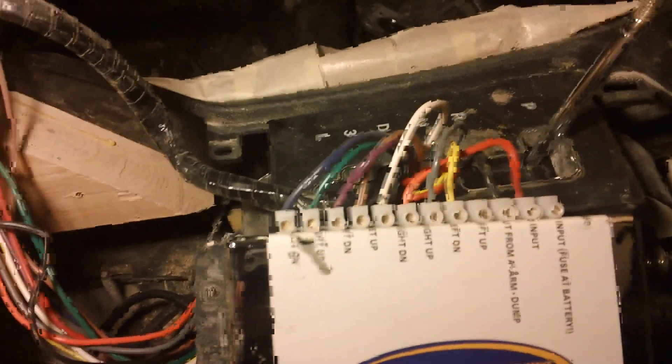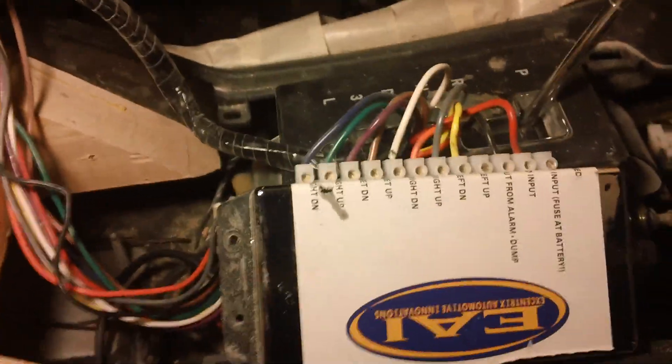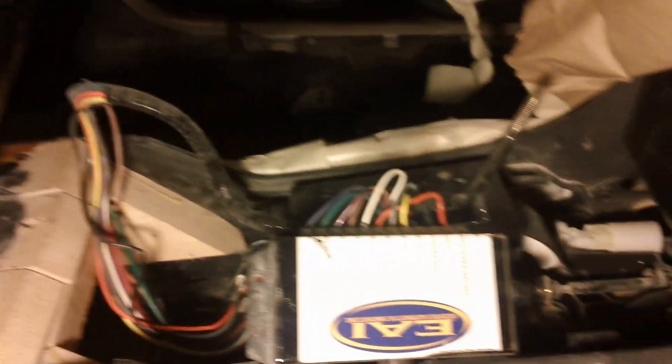If you already have an air ride suspension done this should be pretty simple, because all your wires are already there and labeled. You don't have to do any wiring at the solenoid — you should just be able to pull one wire off at a time from your old box and connect it to the new wiring harness. For those new to my channel wondering why my center console looks different: I'm in the middle of a big car audio project with fiberglass work, so that's why things look a little goofy.